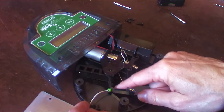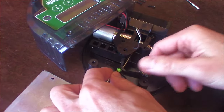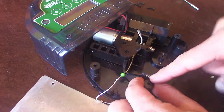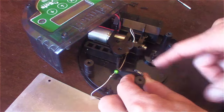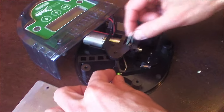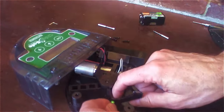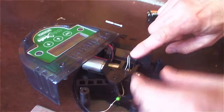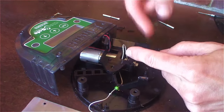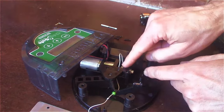This is the string that pulls the door up, and this is like some kind of auto shut-off — when it pulls this much it clicks that over. There's a little metal connection point here which maybe makes contact with something. But the problem is here's the string around the motor spool, all loose, and if I pull on it it doesn't jiggle anything. I think like with my clothesline, the rope can flop off to the side of the roller and jam up — I think that's what's going on in here.